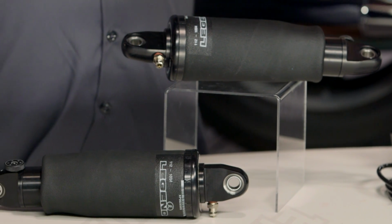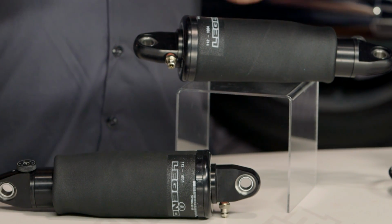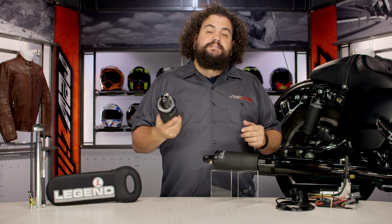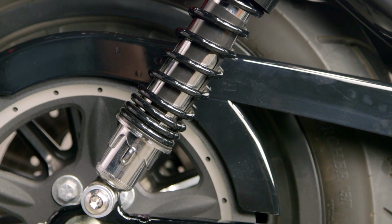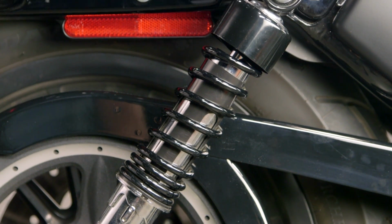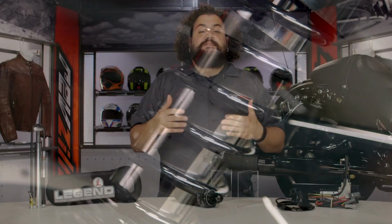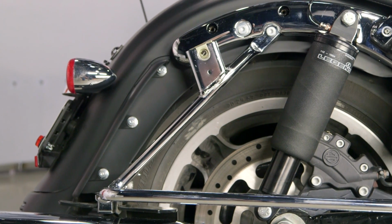Air suspension is, as I said, the king of the heap in terms of suspension. Reason being is that there are no coils. Coils in a traditional shock really are the shortcoming in suspension. Because those coils are made from a certain thickness of wire, they're able to deal with a pretty narrow weight range, so that you can tune a suspension for various things. However, a lot of us are riding in ways where we need a little more adjustability.